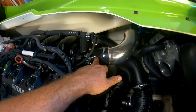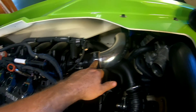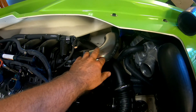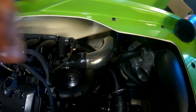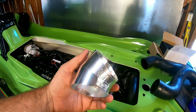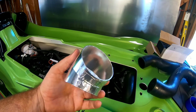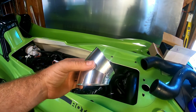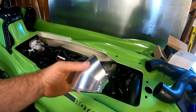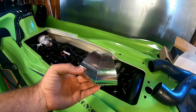This is a reducing coupler from two and five-eighths inch to three inch, and a 90-degree three-inch intercooler pipe that I've already started cutting. I also got two nine-degree cuts out of a straight piece of three-inch piping — these are called pie cuts, and this is what you use when you don't have a mandrel bender. You set your chop saw to nine degrees, though you can really get creative and cut as much as you want.